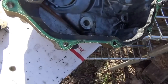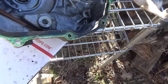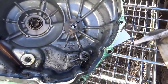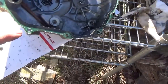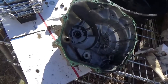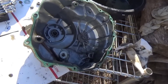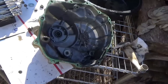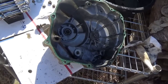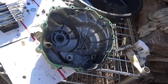Now it's a matter of putting this back in - I've got to take the bolt and washer off, that goes in first, and then as I tighten it down it sits right there. I'm going to have to stand this on its tail and put the cover right back on. The gasket looks really nice, so I'm just going to oil that gasket and put it right back on. I want to get oil into this thing, get it adjusted, make sure it's working right. I do have a gasket to change into this, but if this gasket doesn't leak I'm going to leave it - and if I do have to take it apart later, I have a spare gasket.